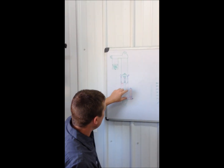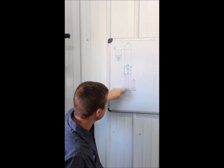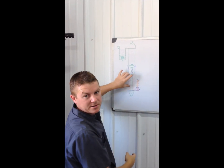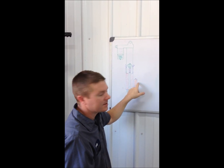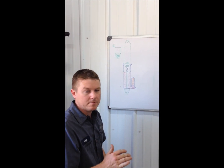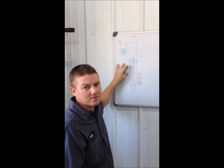Here's your negative spring. As you can see, as the shock is trying to pull apart it's counter-reacting that and sucking the shock back together. Another thing: with two pressures, you always want to fill the higher pressure first. The reason is it's going to force the puck all the way to the bottom. If you put your low pressure side first it's going to push it all the way up, then when you fill the high pressure side it raises your low chamber pressure. Always put the high pressure side in first, or else it's going to throw everything off. Also, always have the bike off the ground when you put your pressures in, or it's going to give you a false reading on your pressure gauge.